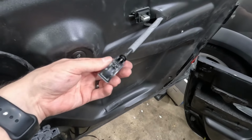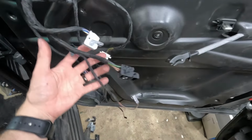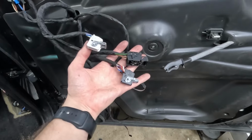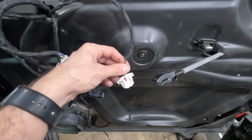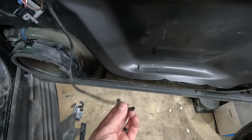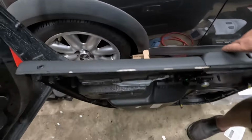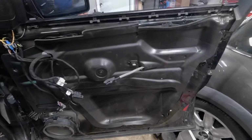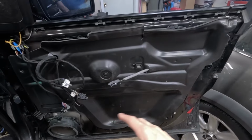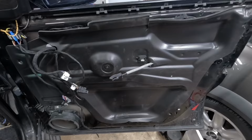This is what the door cable release looks like. Just clips in with this. And we've got this set of cable plugs here. These three go to the module here. This is for the mid-range speaker. And your woofer is down here. And then at the bottom, don't forget there's this one for the door light at the very bottom under the little storage compartment. Now, if you have an older truck before 2007, there's an airbag that lives here, but after Ford took over, that went away.